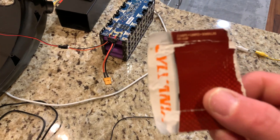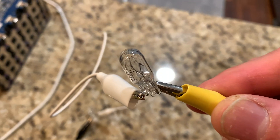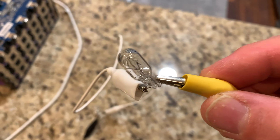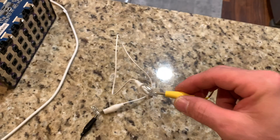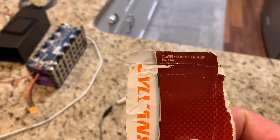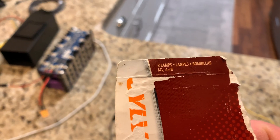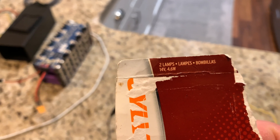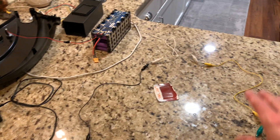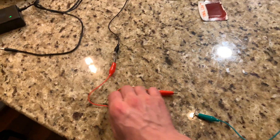What I did was get some automotive bulbs - I had some automotive marker bulbs. They have little tangs on them that bend out and they are standard incandescent bulbs - not LED. You need incandescent because LED won't pull the same amount of current. These are 14 volts each, so 14 volts times four is a little more voltage than this charger can output, which means it's safe and I won't burn the bulbs up.